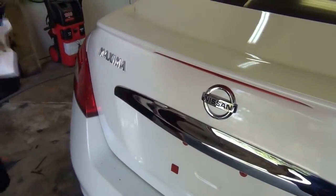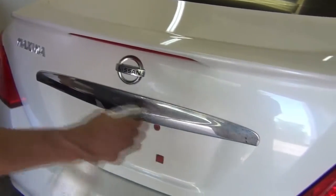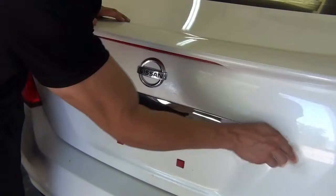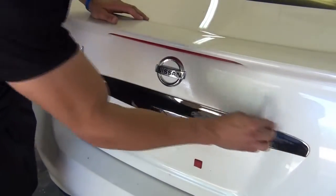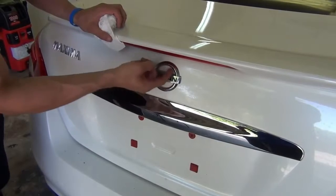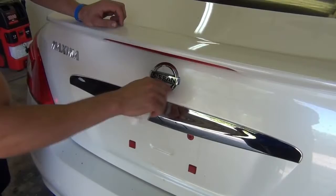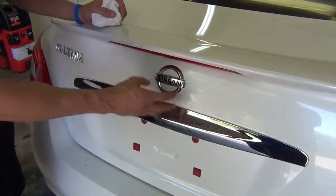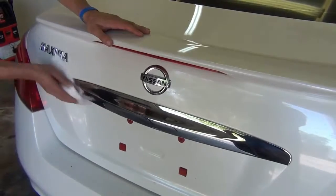What we're going to do is use the pre-dip spray that we use here at DipYourCar, and give a nice amount of product onto each one of the chrome areas. Then just take a paper towel and not only clean them down but really, really thoroughly dry them. One of the biggest mistakes people make when working with Plasti Dip is if you have an edge — like on the inside of the circle on the Nissan logo — they won't dry it out enough, and they'll let some liquid saturate down in that crack. When you spray the Plasti Dip, it's going to shrink away from that liquid and you're going to see some chrome and have to redo it. So make sure it's fully, fully dry.